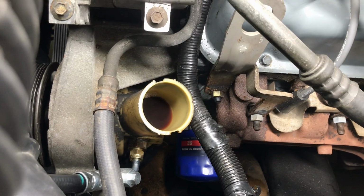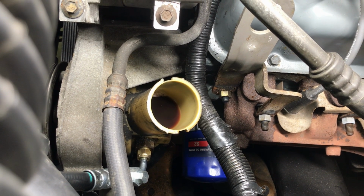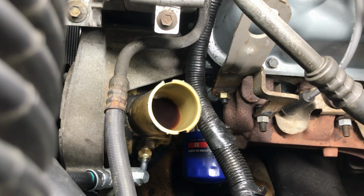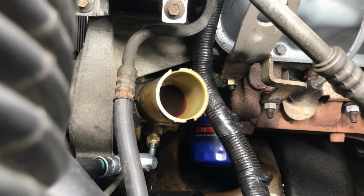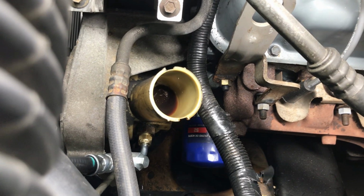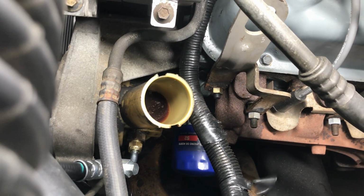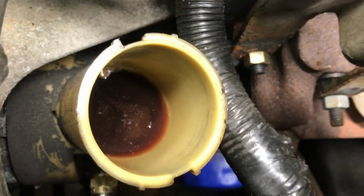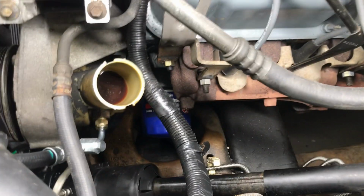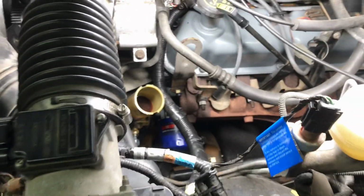All right, so after it sits for a while, all the air basically bleeds out of itself. Then you can start it back up real quick. Go start it, Josh. Start it back up for a second. That's good. That's good. All right, so now we're gonna start it up. That's it. Let the rest of that little bit of air come out. Alright. Let it sit for a little bit again, and then just top it off. It's not that low now, it's only going to come up about another 1/4 inch or so from where it is right now. That's it. Alright, and that's it for that.